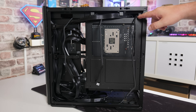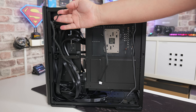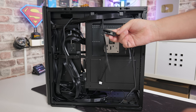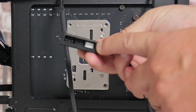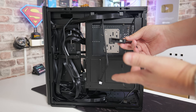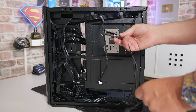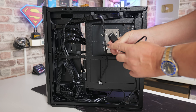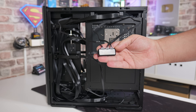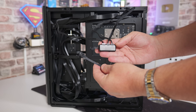For this particular setup we've got one cable coming through for each fan. There is a little hub, and this is probably the easiest way to do the wiring. There is one port on the hub marked in white — that is the fan speed sensing port. It doesn't really matter which fan you put on there since they'll all be running the same speed anyway. Make sure all three fans are plugged in. Then there's a single PWM cable which plugs into the CPU fan header on the motherboard.